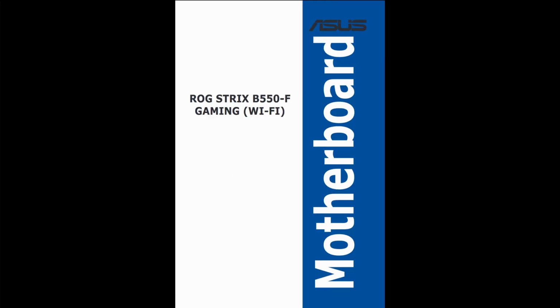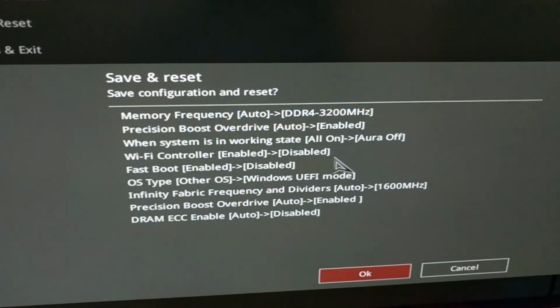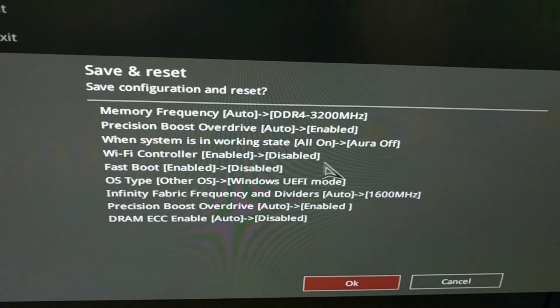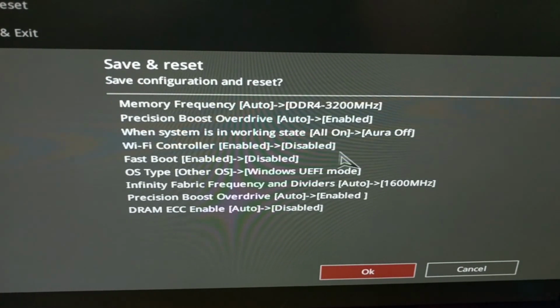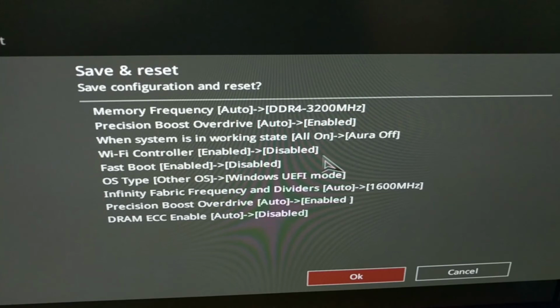What I realized kept happening is that my motherboard was going into safe mode so it could boot, which lets it bypass a lot of checks and settings. Booting was really unstable though because the default timings for memory with only setting the speed were too tight, and I didn't see the AMD DOCP option until later, which is like the XMP profile for Intel. This sets the memory speeds directly and all the timings.